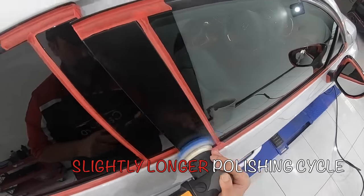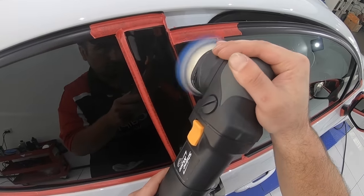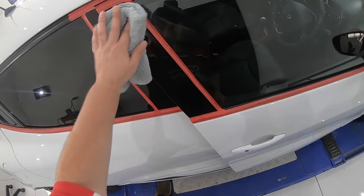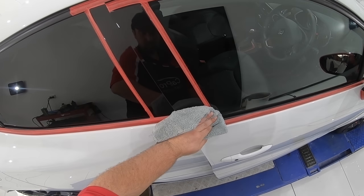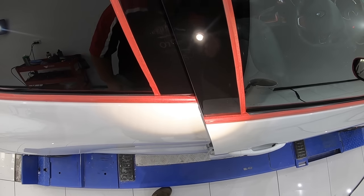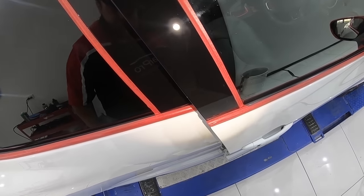But as mentioned, if you're just too aggressive in that first cutting stage, you'll be struggling in the next finishing stage. Or you'll find that what happens is that you have to keep on polishing for longer in your second stage, or do multiple sets, or even step up to something more aggressive, which in turn starts to create more heat and inhibits your ability to finish well, and you just go around in circles chasing your tail and pulling out your hair.